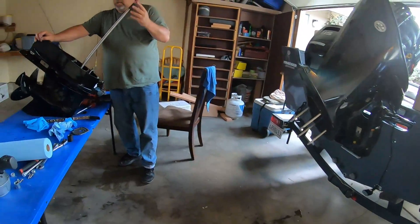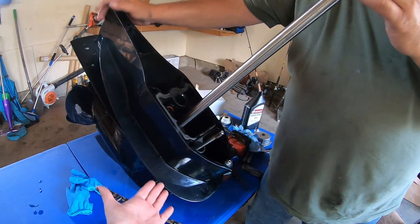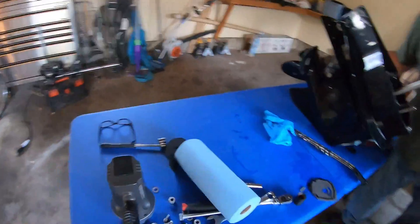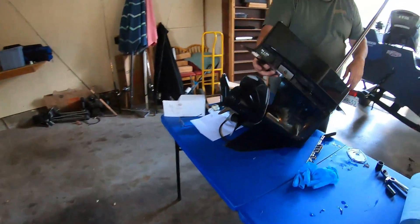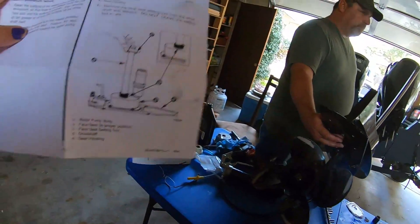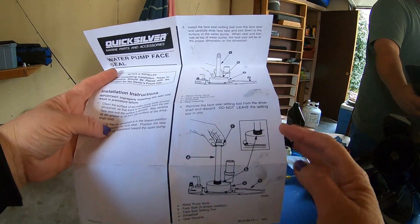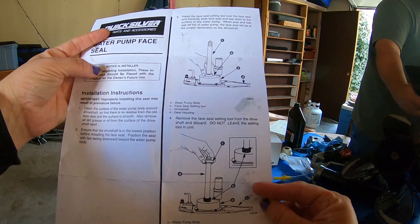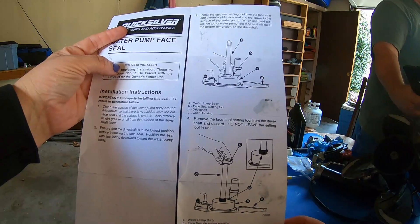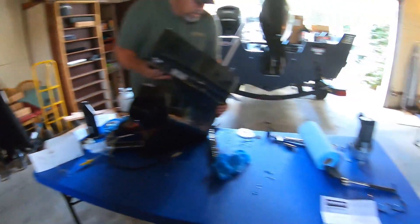Okay guys, we are going to reassemble — here's what we did when the camera was off. We attached this part after we put the bolts back on. We put the seals on. If you look at the directions on your paper, it tells you right here that the seal will be resting on top of the water pump — that's all you do, you slide it on there and slide it down to the surface of the water pump. And this slides back in. Then we are going to take this drive shaft and put it back on to the motor.